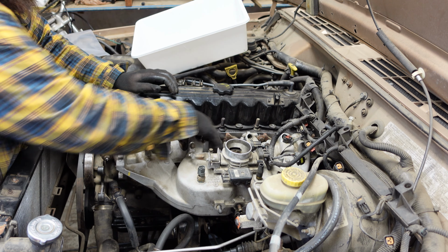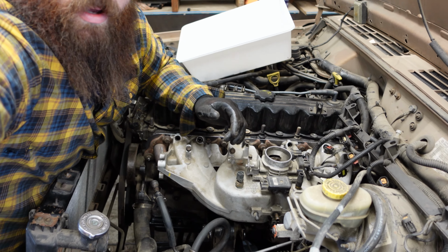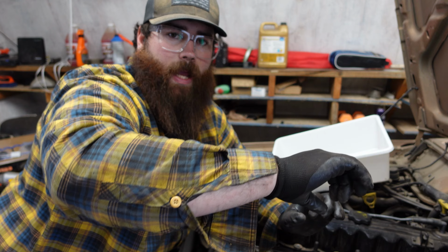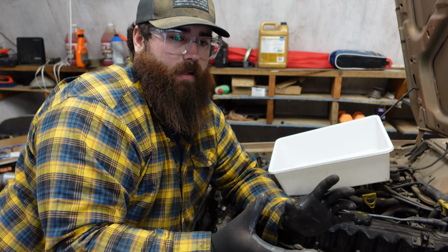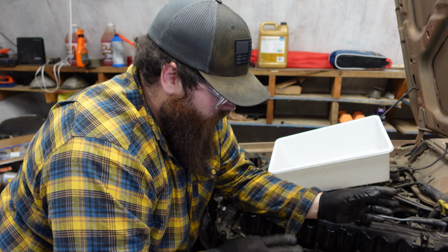Okay, so I went through, got all these bolts in. They aren't torqued down. Basically what I did is, the best thing to do is take a torque wrench and set it to 24 foot-pounds, test it and see, this is the way I do, is I see and feel about how much 24 foot-pounds are. This motor calls for 24 foot-pounds for all these bolts, and then the studs with the nuts on them, they call for 23 foot-pounds.